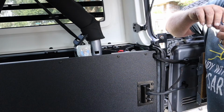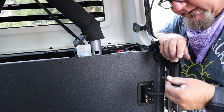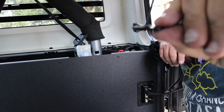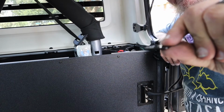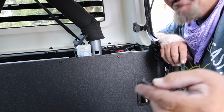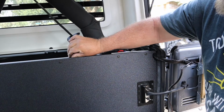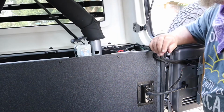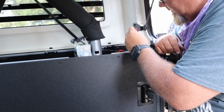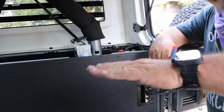So I wanted to show you what I was doing with the little riv nuts or captured nuts that they have. Not riv nuts. If you look, you'll see a little indentation. I don't know if it's going to focus. I'm actually putting the indentation up, and that's what's helping grab onto them. They seem to stay still a little better when you put them in. They're a little bit sturdier and they're sitting flat.